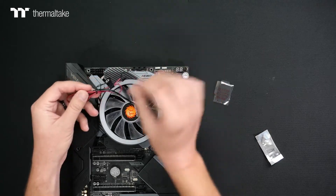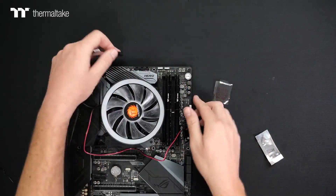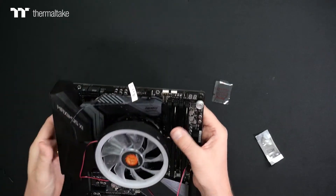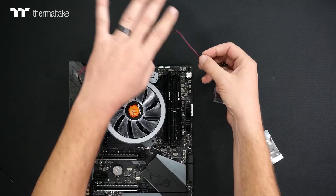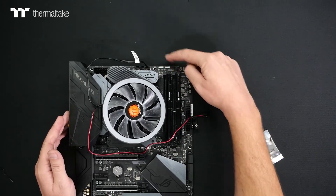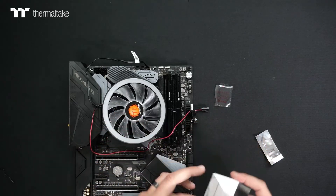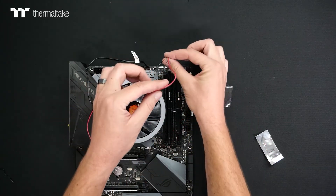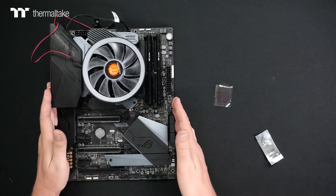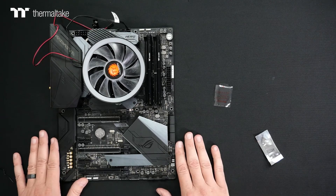The last thing to do is connect the cables. You're going to have two things to connect: one is the three-pin connection going to the CPU fan header on the motherboard, so the motherboard can provide power to the fan and monitor RPMs. Then there's the ARGB connection — if your motherboard supports an ARGB 5-volt connection, the manual has a breakdown of where everything goes for each pin. Refer to that based on your motherboard brand, and the RGB will then be controlled by your motherboard. And that's it for the UX100 Intel installation. Feel free to let us know your take on the UX100, and we'll see you next time.